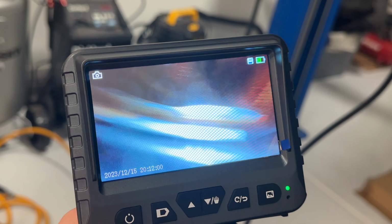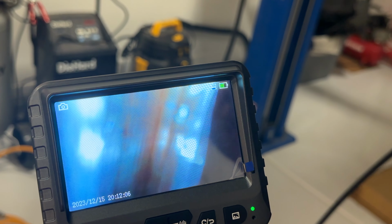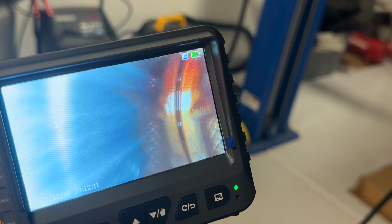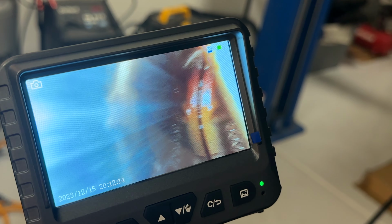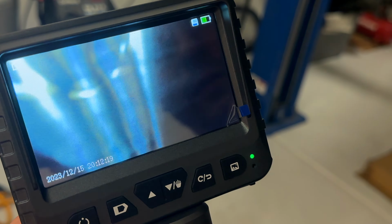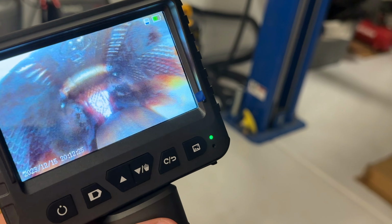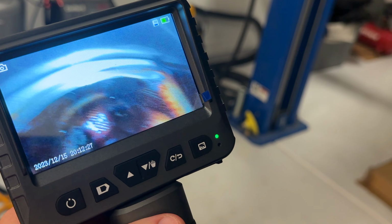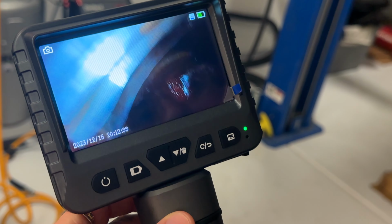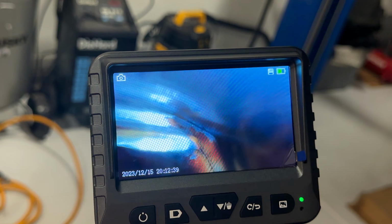be fine. I put water in the cylinders and left it for a couple hours, and you can see it slowly went down. There were no serious issues with piston ring gap or anything that was lost due to catastrophic damage or anything like that. Hard to see in the video, but everything's in pretty much good shape. You can see varnish just from not great or adequate oil changes, but all my sealing surfaces look great. And just honestly, the inside of the cylinders were in wonderful shape for 120,000 miles.